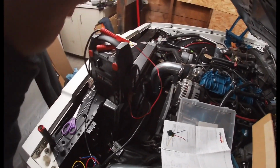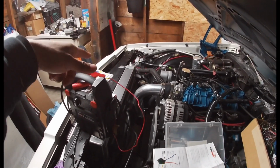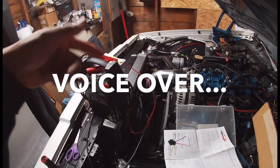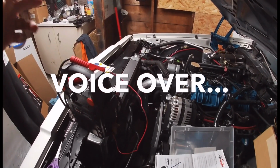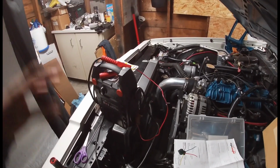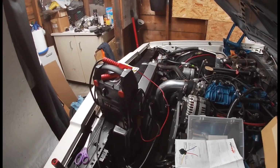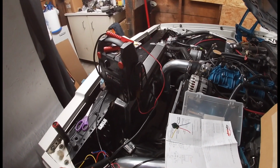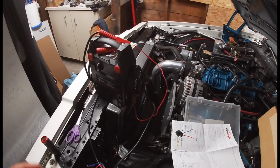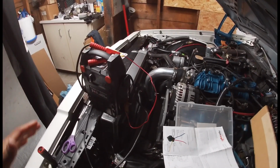On the inside lights over there, since I'm only using that particular pigtail, you're good because you only have the green wire on the bright side anyway, so that's the only wire that you need with the ground. That way the headlights, when they're on, they're only running the 2 outside lights, and then I'll make a separate switch for the 2 inside lights, and they'll all come on at the same time. So I hope that makes sense, y'all. Again, I don't mean to confuse anybody, but that is a way that you can make all 4 lights work.